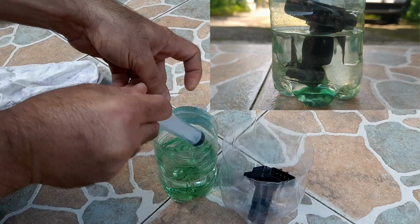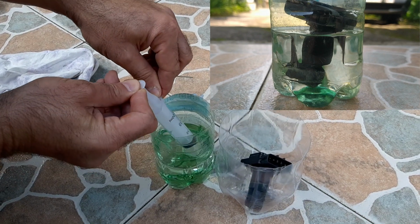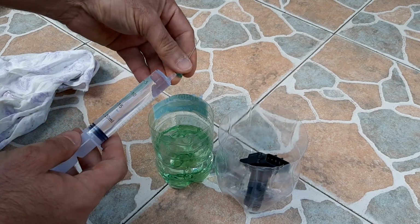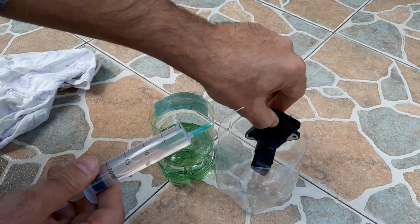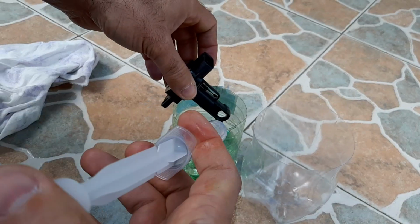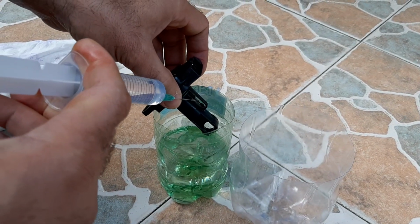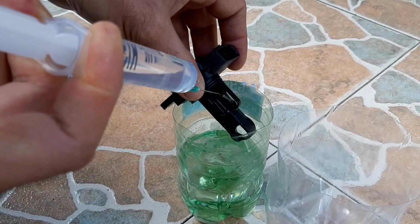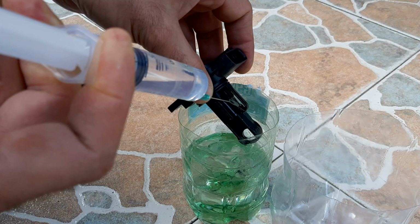First of all, I put the sensitive part of the sensor into the alcohol to soak for some 2 or 3 hours. After that, I take a medical syringe and spray isopropyl alcohol first on the temperature sensor outside, then on the sensitive elements inside the MAF sensor itself. I repeat the procedure some 10 or 15 times.